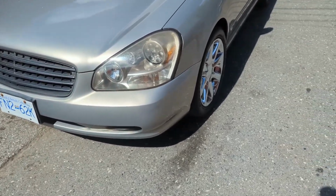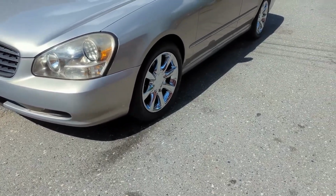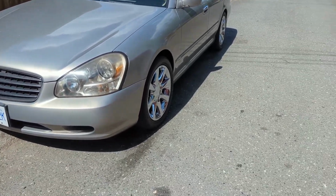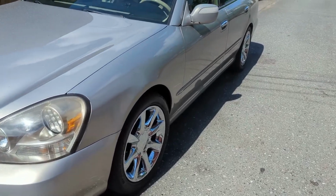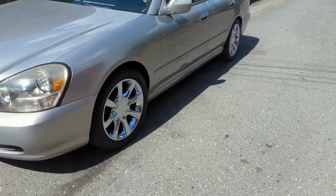I actually read a few forums. There's a BMW inline 6 from the 90s, I'm not sure if it's an M3, where one of their forums mentioned loose spark plugs being very, very finicky, even to the point where a correct torque spec, I think it was 17 pounds, would cause issues. Now, most of these were forced induction. Most of these are not stock engines, which is why this was so weird.